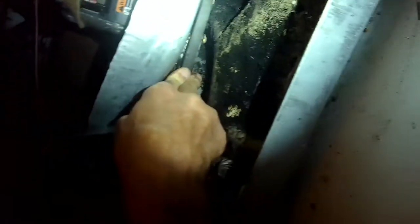So now I get it over those 2 pulleys in the front, and the white pulley has a spring load to it, so it's going to move away from me toward the back of the washer, and I'm going to feed it onto that bigger pulley, and then I'm going to turn that pulley with my left hand. I'm going to turn it away from me toward my left, and that's going to feed that onto those smaller pulleys. And now it's fed on, and that's about it.